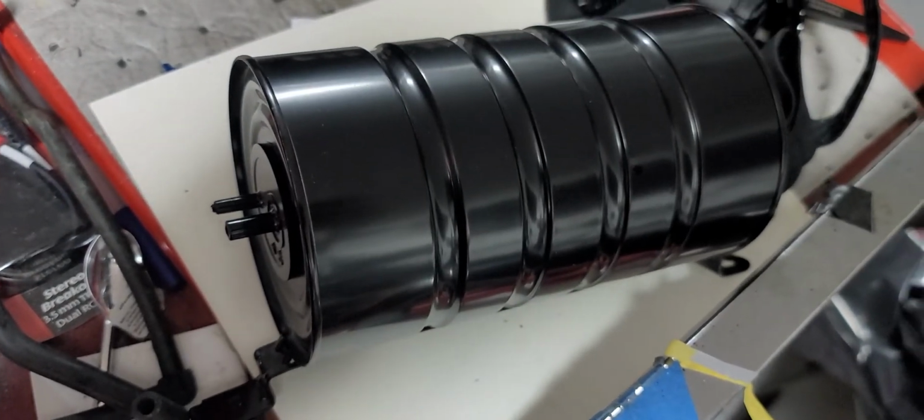All right, let's go get ready for reinstallation now. Okay, the first thing you're going to want to do is put this clip back in this bracket so that you can actually install the can. There we go. We're back on, and now it's a simple matter of just sliding the can in and bolting it in place. Now, one of the hoses is attached to the vacuum lines that run the circumference of the engine compartment.